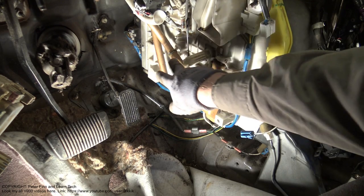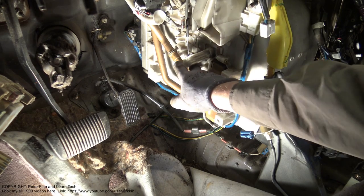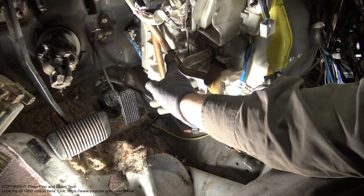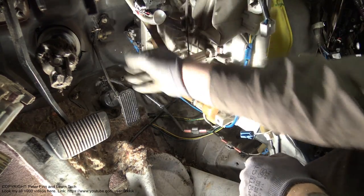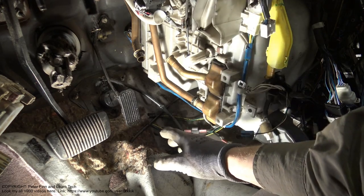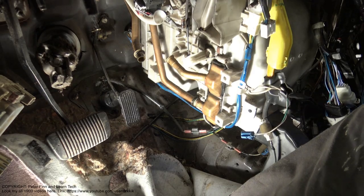These pipes are quite soft, because copper is soft. Carefully, I recommend that I take my hand in here and move a little bit, there is this joint, look, and then I move the pipe a little bit away. Normally it is full of coolant, so please insert a canister here, because the coolant drips out onto this mattress.